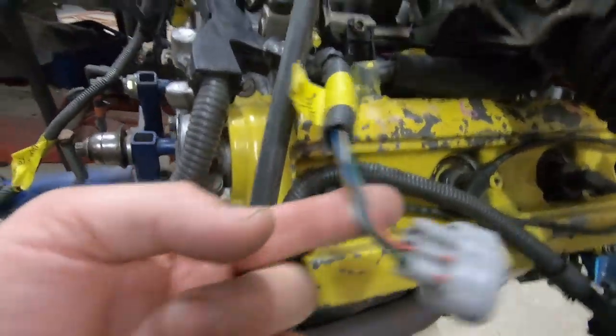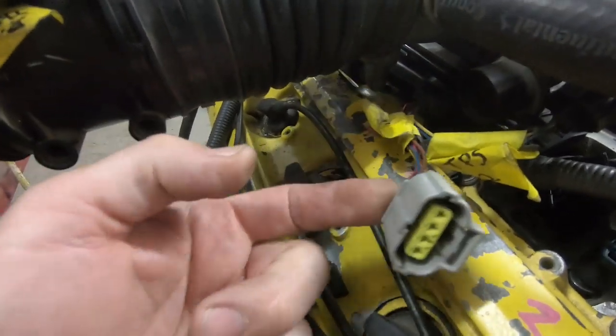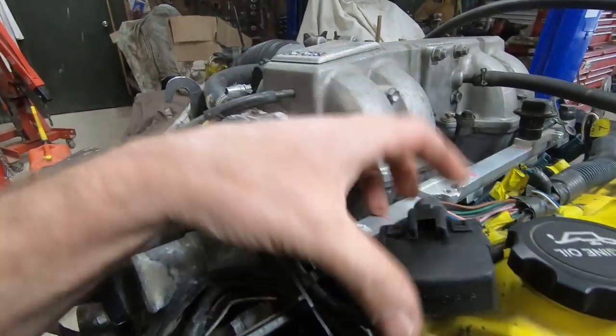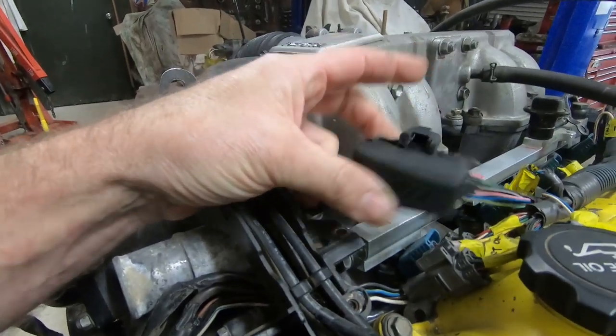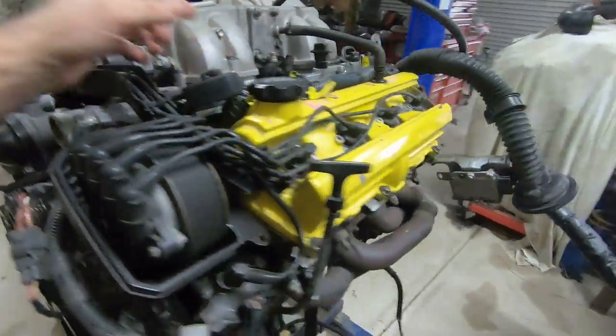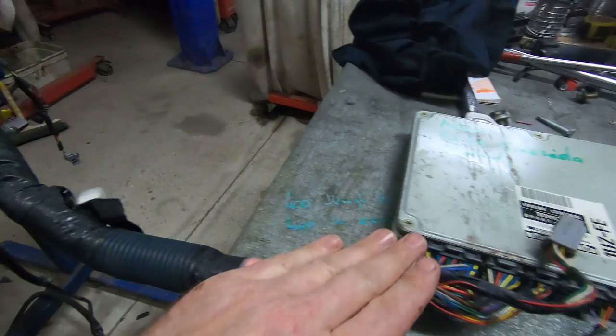This one is traction control. So that's coming out. And the TPS plug, the sub-TPS plug, is coming out as well. There will be a fan switch added, and the diagnostic box will be modified to plug in to a scan tool. So that will work. This length here stays the same because I'm working with this loom.